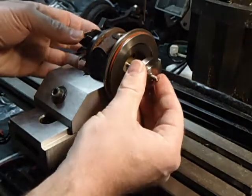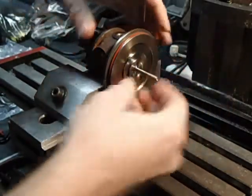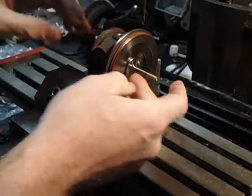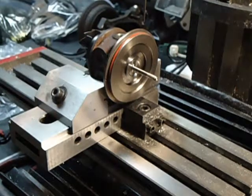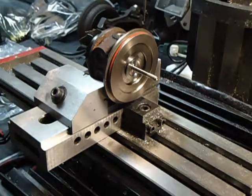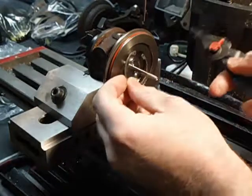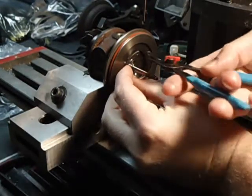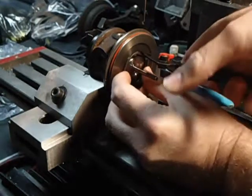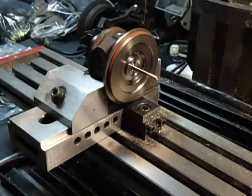This has to line up with this little hole here, so I'll just move my turbo shaft. This will go on, and then this gets pushed in. Let's see if I can get it past that o-ring — right there, that should be decent enough. Now we've got the snap ring that goes on. Let's see if I can do this with the camera in the way — we've got our snap ring pliers. Snap that in. Now that's together.